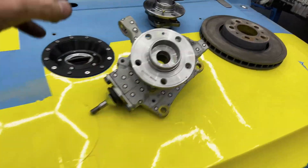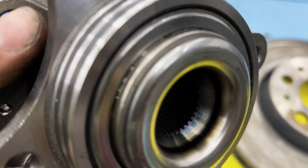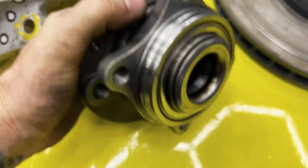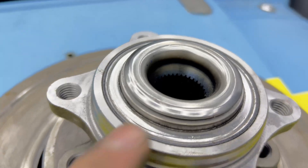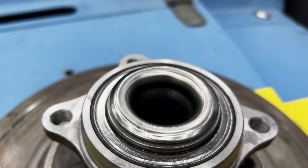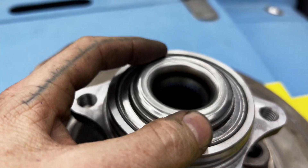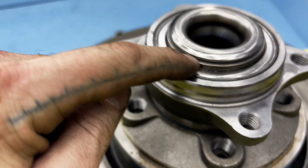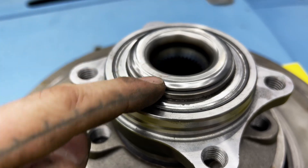The newer wheel bearings that I have look a little bit different — they don't have these hammer marks, but they have heat marks on the inside. You can see a ring of discoloration, and I think they heat it up with some kind of induction heating and then use a press to peen over this edge and lock everything in place. So that's the black part you saw before — slightly darker gray — and this is the actual part that moves.